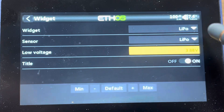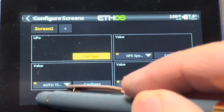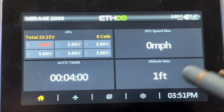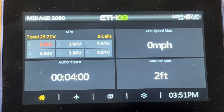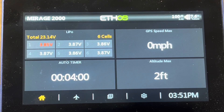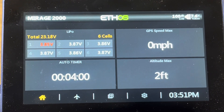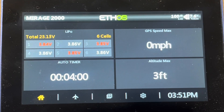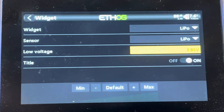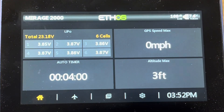I don't want 3.88 — that's too high. I'll set it to about 3.85 to test in action. With one cell sitting at 3.85, when I turn on my motor you can see as it starts to pull down on those cells, they start to turn red. Those cells are under load, dropping below 3.85 and turning red. When I let up on power, the load ends, the voltage goes back up and they're okay — so low voltage is working because as it pulls below my threshold they turn red. Now I'll set it back to my real threshold of 3.6 volts, and everything shows okay.